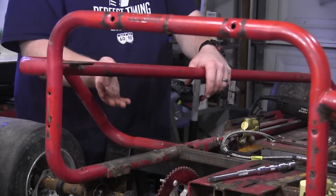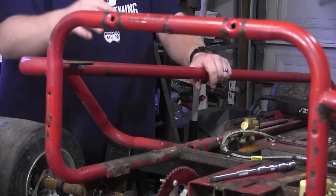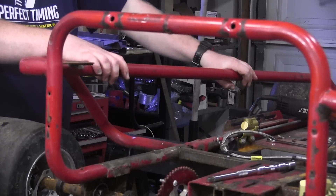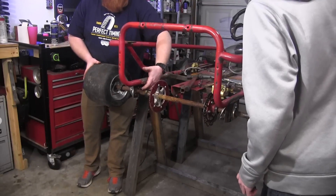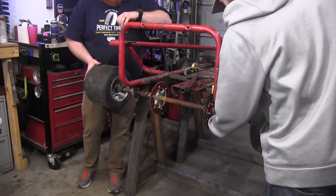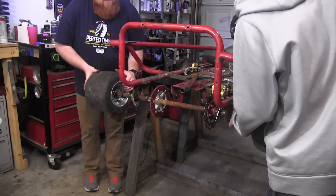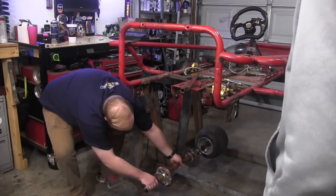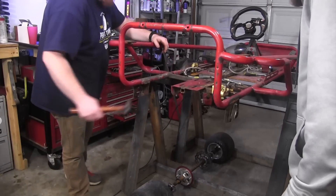After we get the engine all mounted up we're going to clean all this old piping up. You've got to be real easy with this piping because it's super thin walled. I am getting all the pipe bent right now to rebuild this whole go-kart exactly like this, just out of quality roll cage piping. I took a hammer and a punch and knocked this bearing — it was just seized on from where it had rusted. I'm going to take this whole axle shaft and sand it down, make it polished again, and make sure I oil it before setting it outside. Now we can drop this axle down off of these hangers and we'll worry about the axle later. Now we can get to adapting the new engine plate.